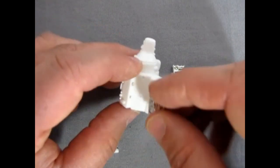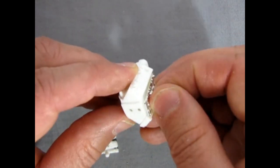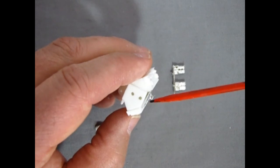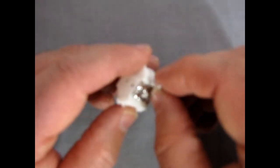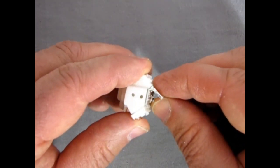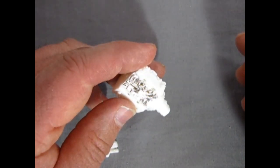Now with our Hillborn fuel injection, I will suggest to remove it, because even if you push this down, it doesn't quite get right onto the top of the engine block like it should. That will cause some interference issues with our injectors going in place. So again, remove the pin and let that chrome unit get right down to the bottom.